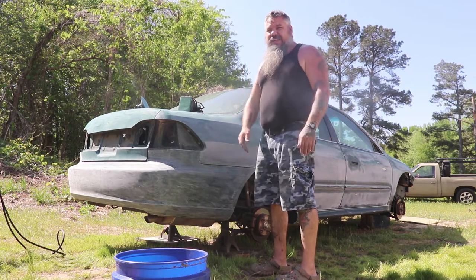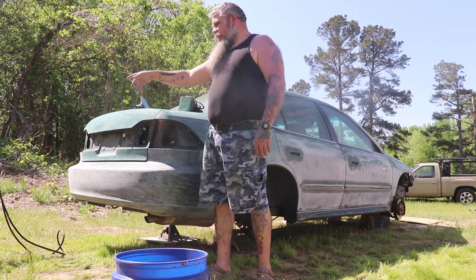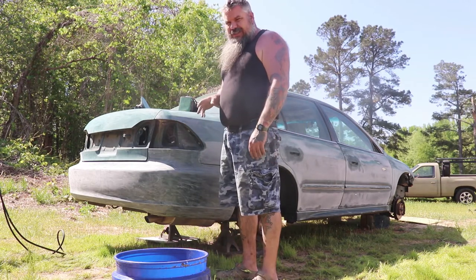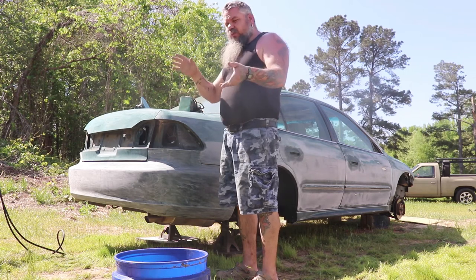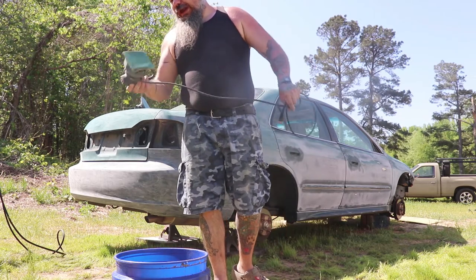All right, so it's sanding time - this is the next day. I already sanded a bunch yesterday. That 21-gallon air compressor is barely keeping up with the sanding I'm having to do - it's constantly running. It's not the best compressor for sanding a car, but it's what we got. What I ended up doing with those 320-grit pads - they're not bad pads, they're good for a final sand. I already had this Black & Decker square electric sander and some 120-grit pads, so I ended up doing the whole car with this first.